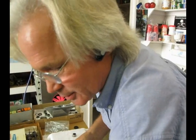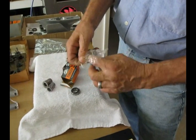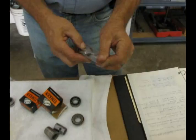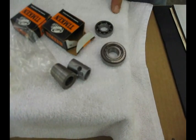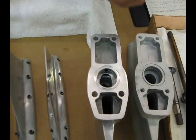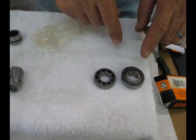Basically what we've done is we matched a Timken rolling element bearing. We re-machined and had a Timken rolling element bearing put in — and this is the matching race, you actually order them separately. This is a Timken tapered roller. I put that bearing in the top of the unit — it fits wonderfully. This is a unit that's been machined to accept that bearing package. That right there replaces the original bearing. That is a Timken tapered roller bearing, good to about 14,000 RPM.